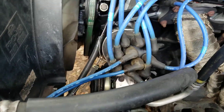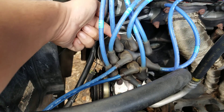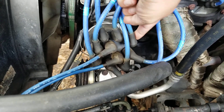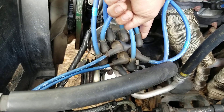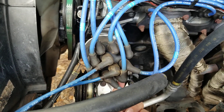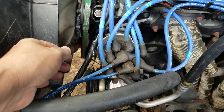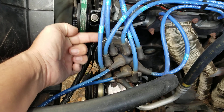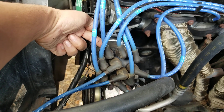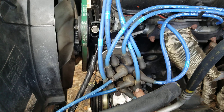I'll number them out the proper way this time. So this is intake one, intake two, intake four, and intake three — sorry about that, I had to make sure I get them right. One more time: intake one right here, intake two — and you're essentially skipping a spot each time. So intake one, skip one, intake two, skip one, intake four, skip one, and intake three.